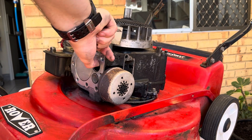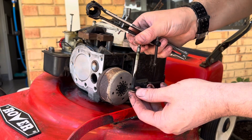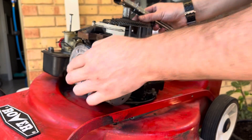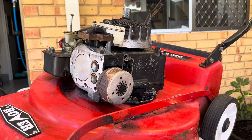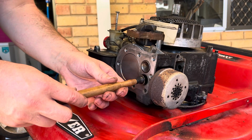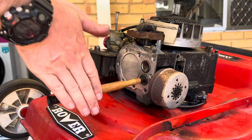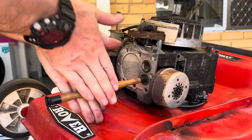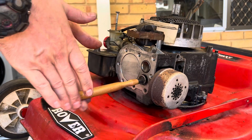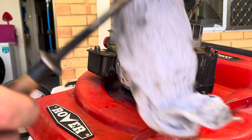Checking for burning or if it's been held open - actually it doesn't look too bad, in fact it looks really good. I couldn't resist a sneaky look at the exhaust and actually it could probably do with a bit of a lap to be fair. It is spinning - let me just lap it quick, just get the job done. Just a little bit of valve lapping compound, just a small amount. Quick look - that's better now, we've got a nice ring. Perfect.